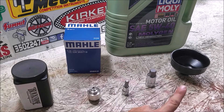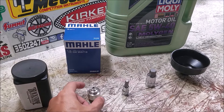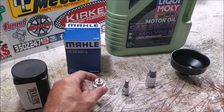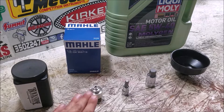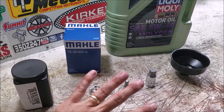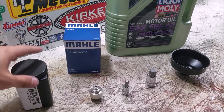To get the old valve out, right next to where the oil filter is there's a place to put your M14 - you just back that out and the valve falls right out. There's a factory spring you'll swap over from the old valve to the new one, then put everything back in. Because there is oil behind this, we'll go ahead and drain all the oil out first, then install the valve and put the filter back in.